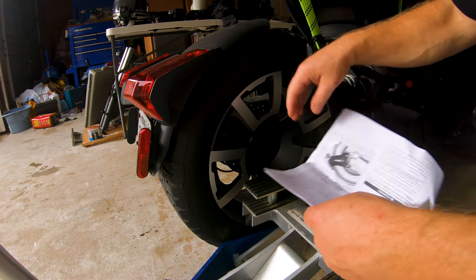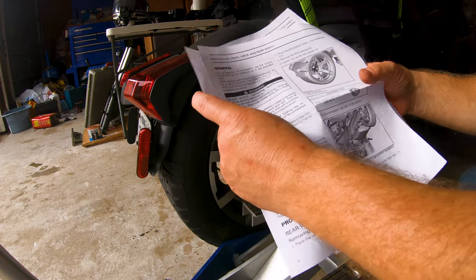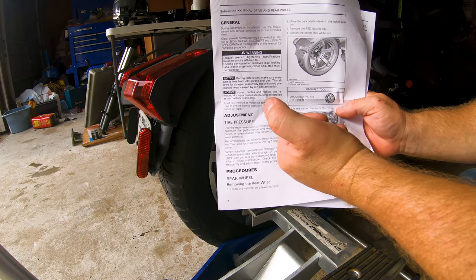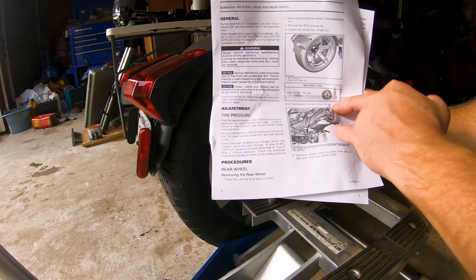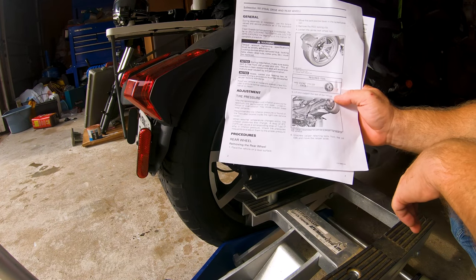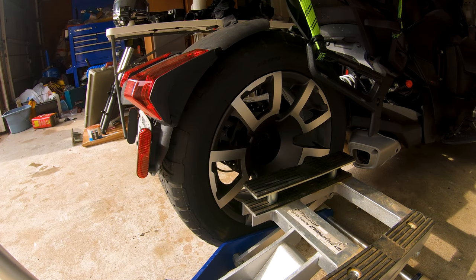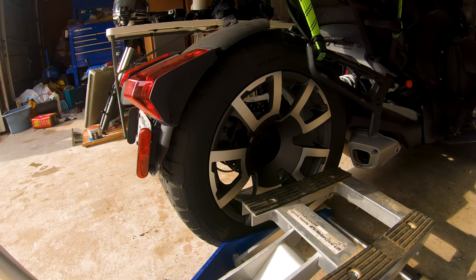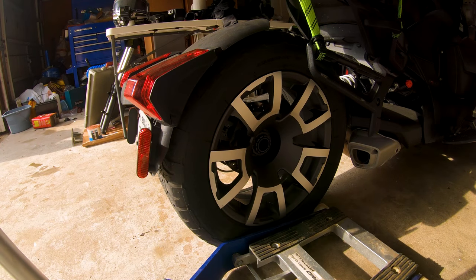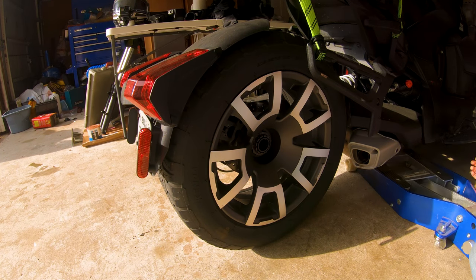So, per the shop manual, they want you to jack it up right here, almost in line with the inlet of the muffler on the front. So there's a couple of jacking points on the chassis, and what that's going to do is kind of lift it up and put the weight bias on the front wheels and unload the rear, so we think. Let's see if it works.